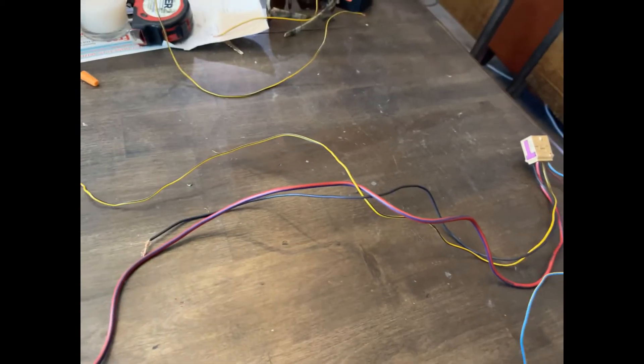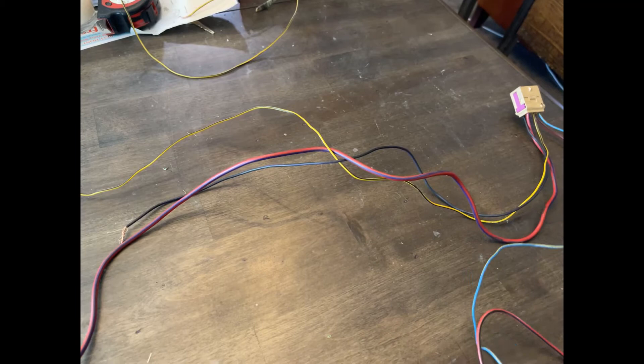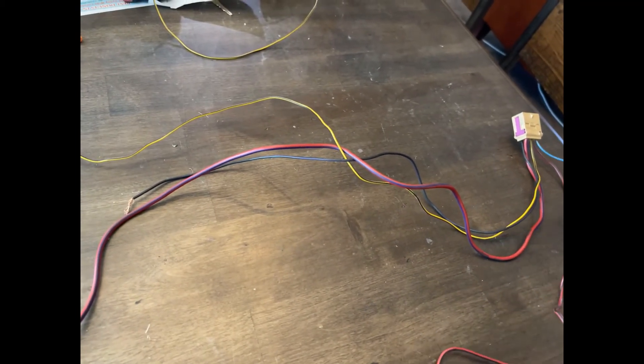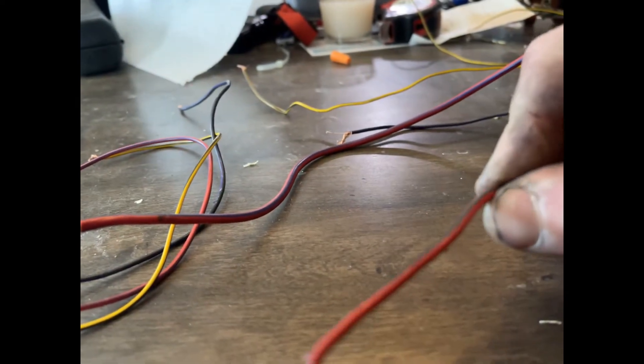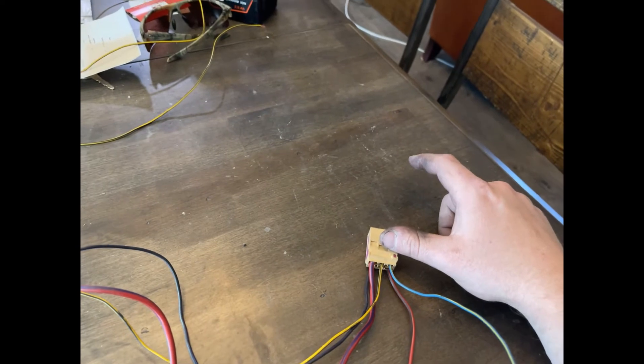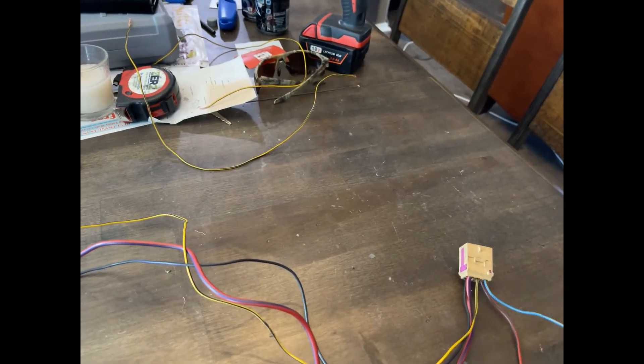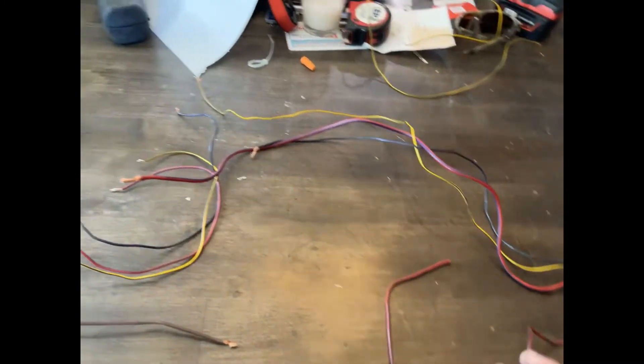There are also two wires coming off this brown connector: a teal-yellow wire that is unconnected on my standalone harness — some of you may have that different; it's the same color as the wire that goes to the blue connector getting 12 volts, so you may want to connect those. There's also a smaller gauge red-and-black wire, not to be confused with the red-and-purple wire — this red-and-black was cut on the other side of my brown connector, as it was power for the automatic transmission module. I'm saving these wires long in case I want to run accessories or a fuse block off them later.